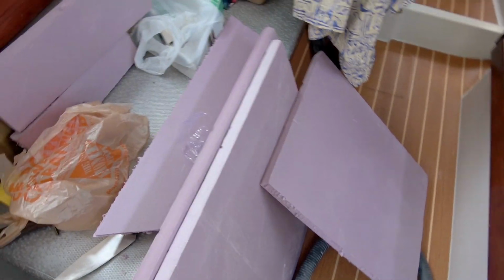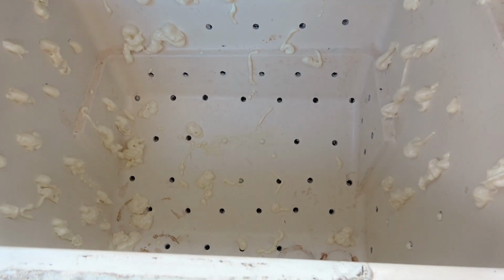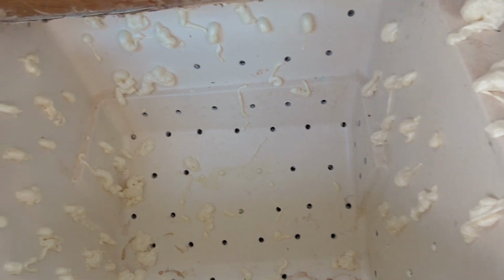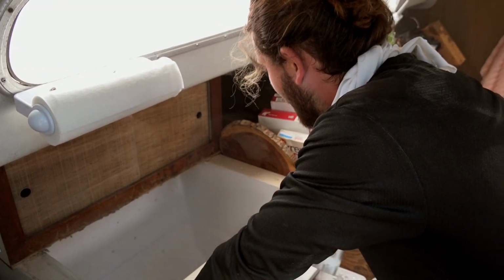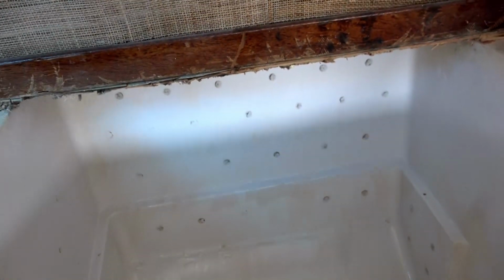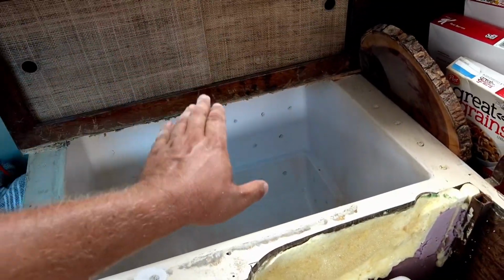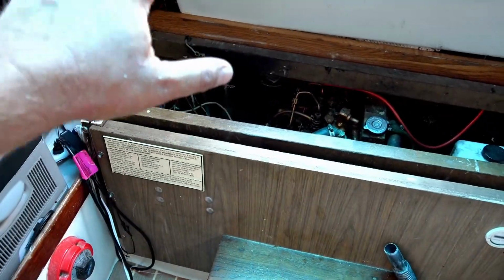It's expanding foam, so you can just use a knife to cut it off, and sand it back. I'm thinking maybe I'm gonna do a layer of fiberglass on the inside here. We've got a nice matte fiberglass, and then I just run one layer around this and maybe just hit it with a coat of paint as well. So now I'm applying the second coat of this epoxy primer. Hopefully it will look good after this one, eh? So we're just waiting for it to dry after we sanded it, and then that new piece of wood's gonna go on there. This floor is in, that floor is in, and this is where that new piece is gonna go, right there. So there's uniformity coming down.